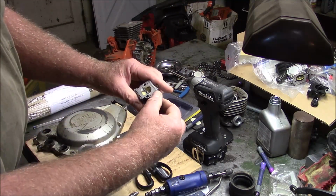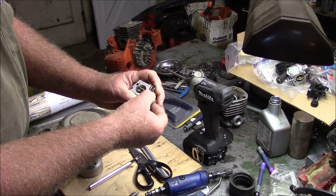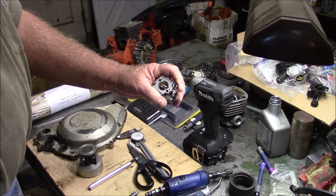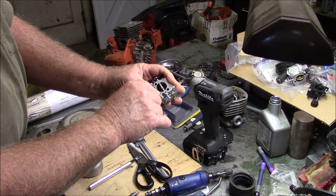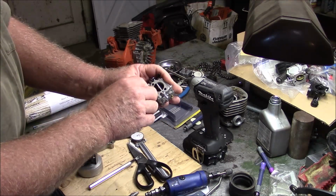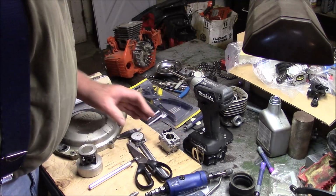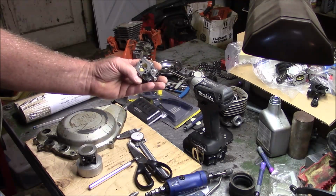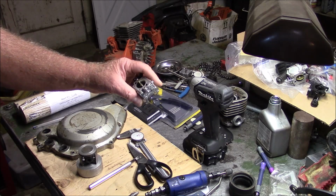And by using these, imagine the cross-sectional area of a carburetor is also reduced by things like the choke and the throttle. The diameter of this is ever so slightly larger than a stock one, but not so large that there's a big lip between the carburetor and the standard boot. You know what I'm saying? It's just a little bit. And I found these carburetors, tweaked properly, work really nice. A little goofy. You got to rotate them.